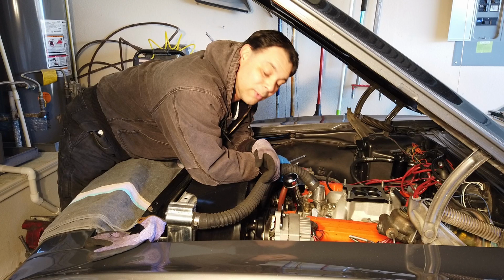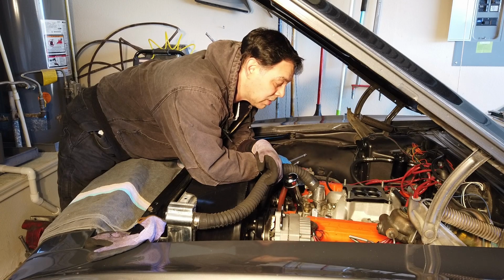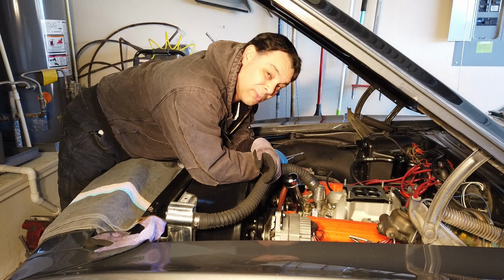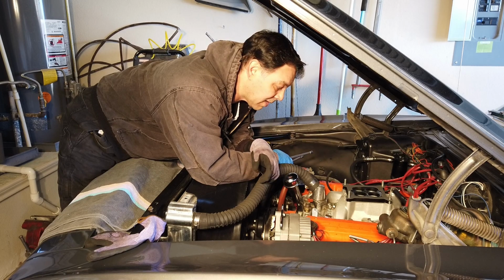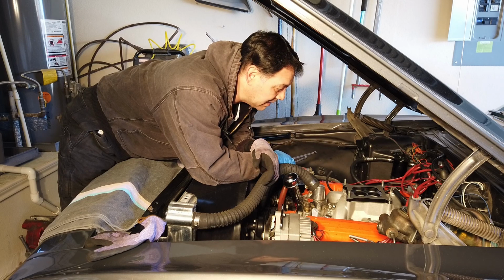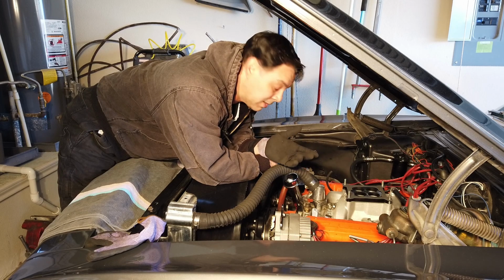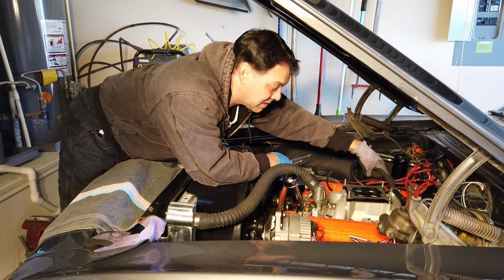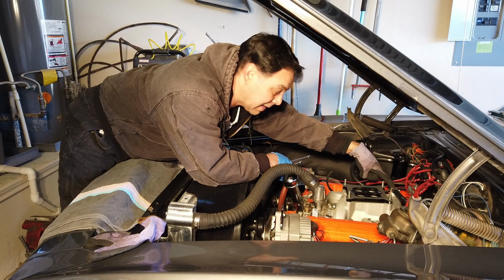So, problem number one. The Killshot doesn't sit in here nicely. I absolutely need this riser, apparently, but the riser isn't tall enough. So, I'm either going to have to go out and get a taller riser, which I don't really want to do, because the problem here is that I have, and I'm not sure you can see it on camera right now, a T right here coming straight out of my manifold vacuum.